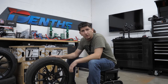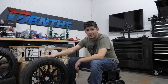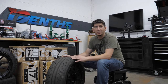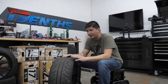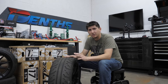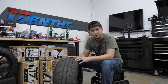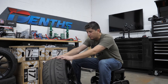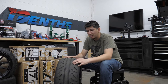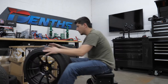This is one of my favorite wheels — best bang for the buck I think you can get. Strong enough to be raced on, yet cheap enough that you can drift with. Hence why I got quite a few of them. What I was hoping to accomplish was to have one set of 17s for the front and three sets of 17s for the rear. I'd rather spend my time in the seat rather than trying to figure out ways to change tires. So instead of buying nicer wheels, I bought extra sets of rears. Now, for the fronts, from what I've gathered from hours and hours of YouTube research, we're going to need a lot of front grip. I have a slightly used set of RE71Rs — the tires we use on the BRZ for autocross. Great tire with a lot of grip at just about any temperature.